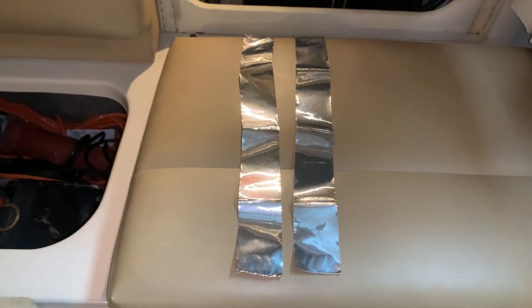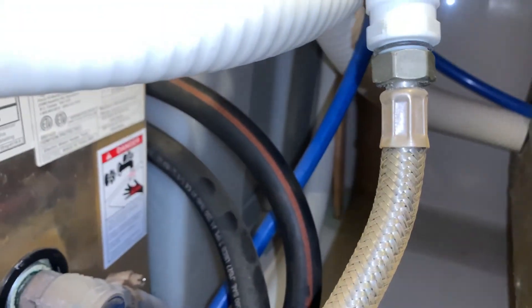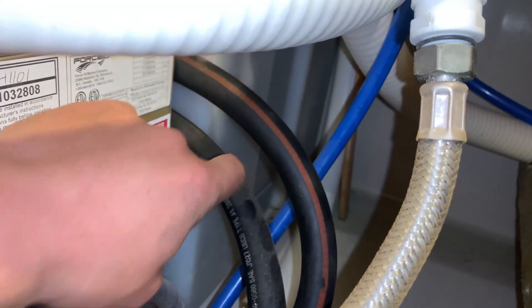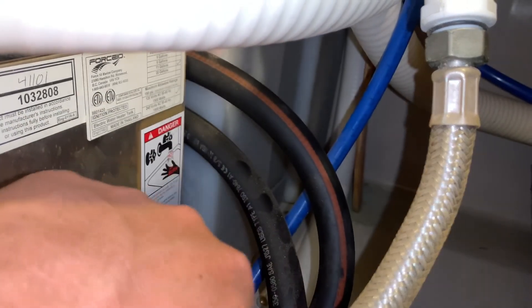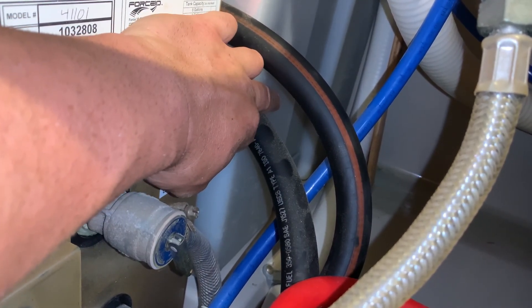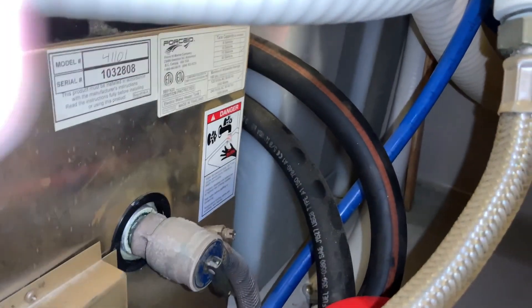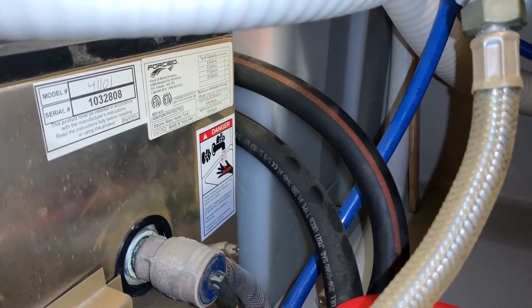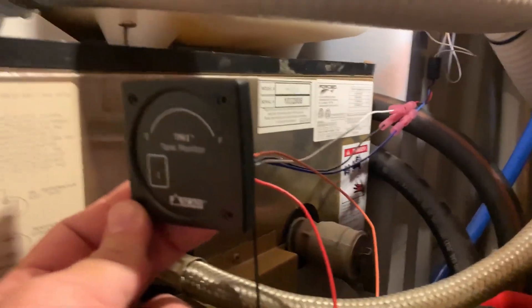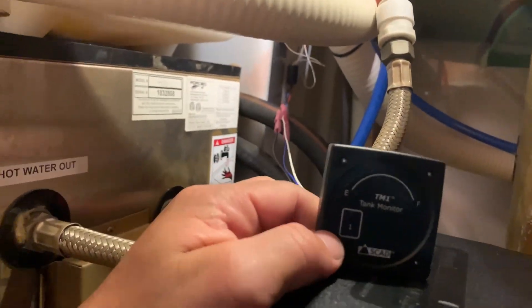There are my two pieces there. Right down here there's a little aluminum mount, and the tank is actually divided into three sections. So what I'm going to have to do is put the two pieces on this section, and another one right here as far away as I can to get that one and three-quarter inch gap. All the sensors and stuff are stuck up on the tank. One of the mistakes I made was making these wires connect directly up to it — you really should have an extension, but right now I'm just looking for a proof of concept to see if it works.